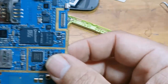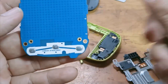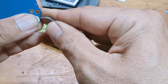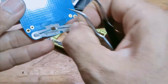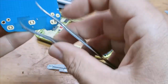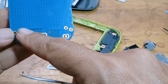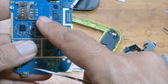I won't talk too much about the structure of the mainboard — I'll just give a brief overview and go into the main issue, which is dead keys (liệt phím). The structure here consists of 3 buttons — these are physical buttons, not touch buttons, even though this phone uses a touchscreen. This phone is an older model. A keypad is designed like a matrix of rows and columns. When you press a button, the positions that make contact allow the CPU to identify which key you are pressing.